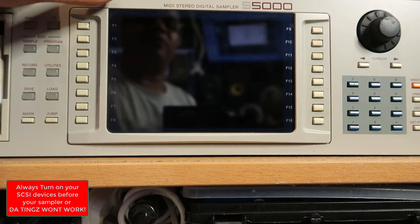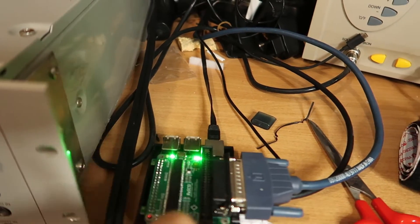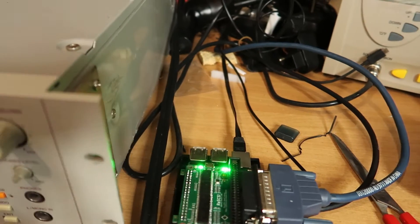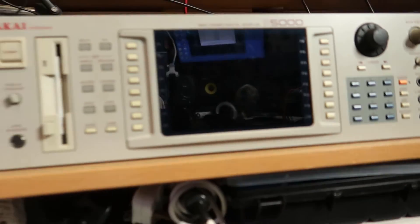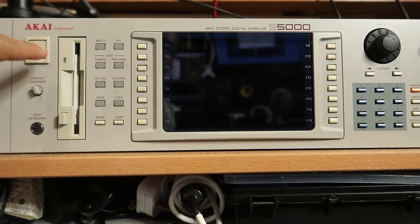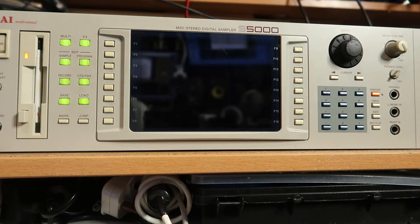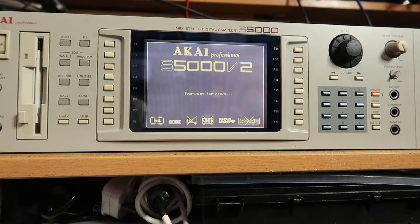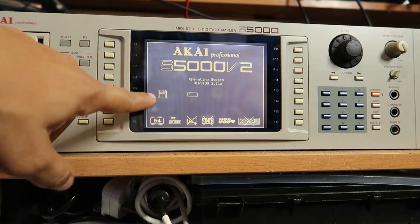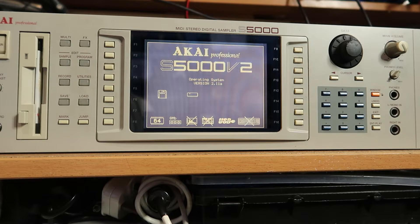As you can see, I've got my Akai S5000 switched off at the moment, and down here I've got the RaSCSI switched on and powered up. I've connected it through the DB25 cable which goes around the back into the Akai S5000. I'm going to power it on now. Once you've been through all the setup procedure — there are loads of tutorials on that, and I mentioned how to get it going in my previous video — you can see it booting up and it's found a disc, which is the RaSCSI.